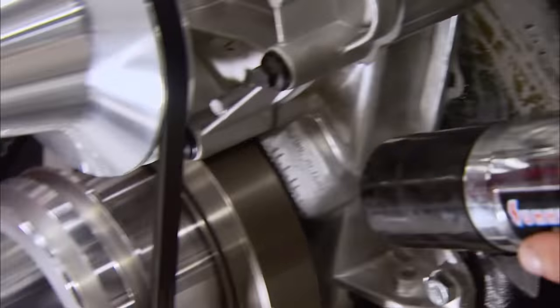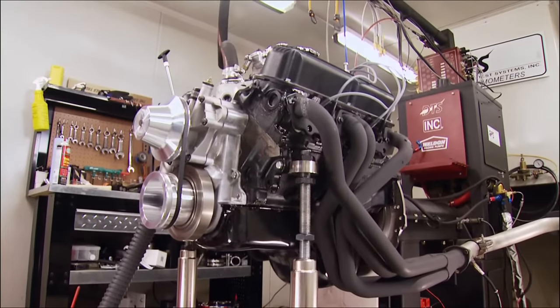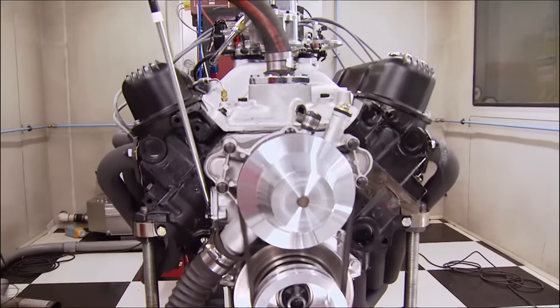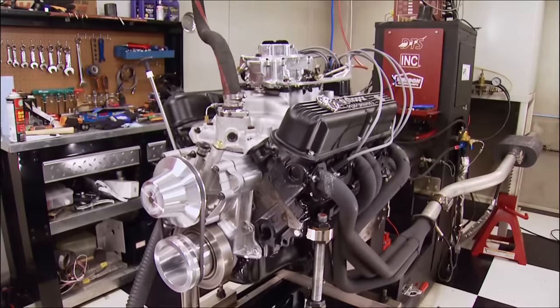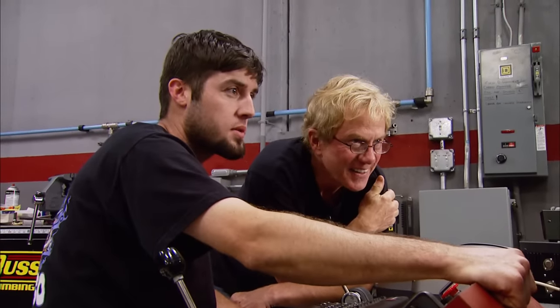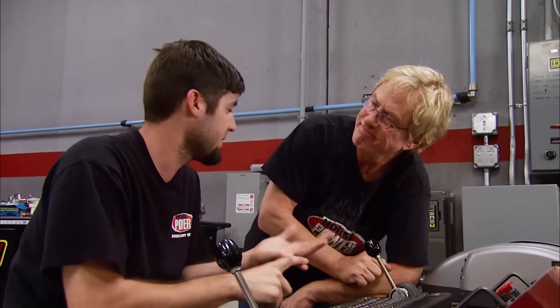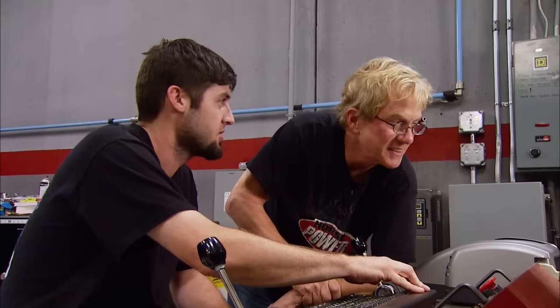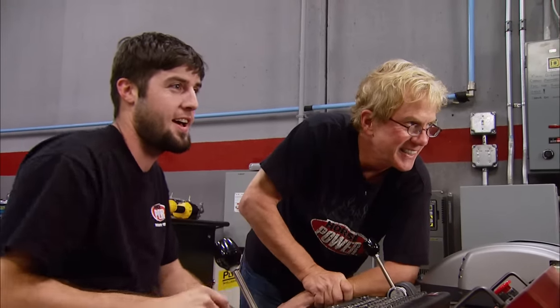Of course, nice is not good enough. Changing the timing in tiny increments, he's determined to squeeze a few more ponies out of this 360. And persistence has a payoff — a grand total of 314 horsepower. Power is a really nice flat curve, no hiccups, no dips. This motor would be good in a truck, a heavy passenger car, your Duster — all around a good motor. And this is just stock, but we've still got a performance deal, and soon we'll bring it back for a performance build-up.